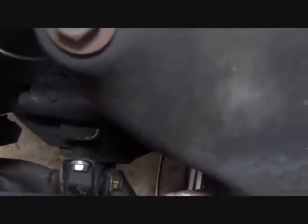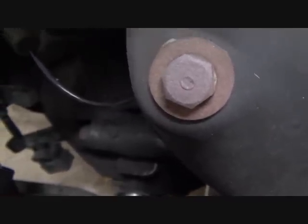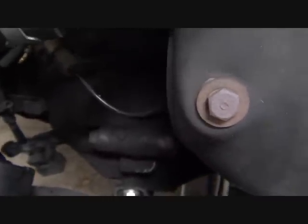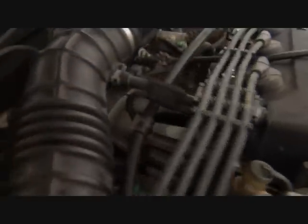You've got to remember, when you're removing things, keep in mind that we want to be able to move the transaxle towards the passenger side of the car, so we can clear the splines on the input shaft. So there's a couple different mounts. Here's a side mount over here, and where it mounts on the transaxle. Kind of darken the hole there. But anyway, you look around, you'll see all the points. Here's one in the back, rear mount. Kind of the hose in the way there.